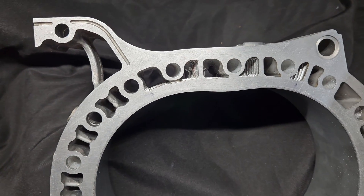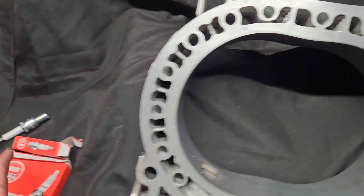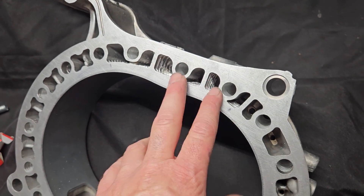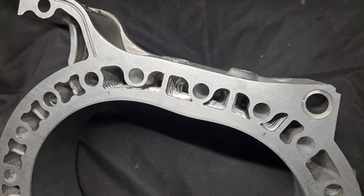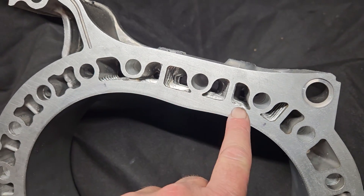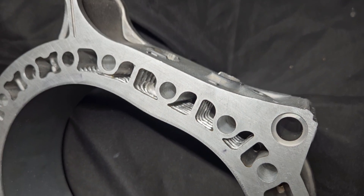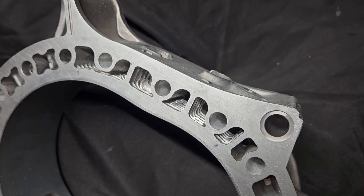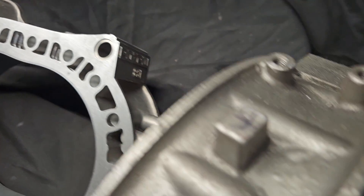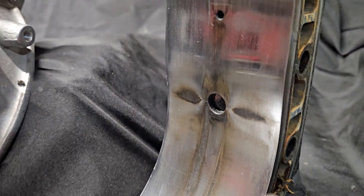Having the right tune, having the right spark plug, having a good cooling system that operates properly along with a cooling jacket mod can help rotaries sustain some of the most extreme conditions and help with longevity in application. And I've got an example right here of a rotor housing that failed due to excessive heat buildup.